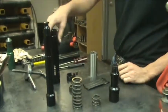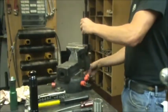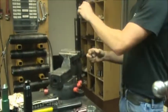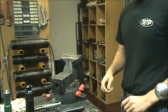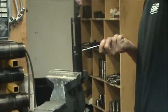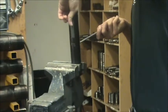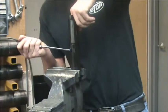Alright, first thing I do is I take my skirt, clamp it in the vise. Dog spring first, dog washer, dog spring first, dog washer. Take your screwdriver, coming through the window, put it down, dog washer, take your dog all the way around.